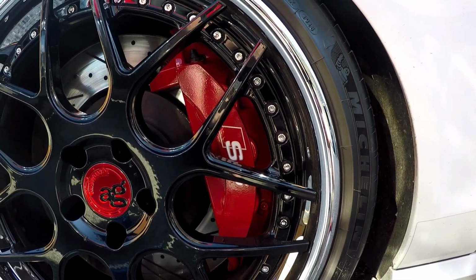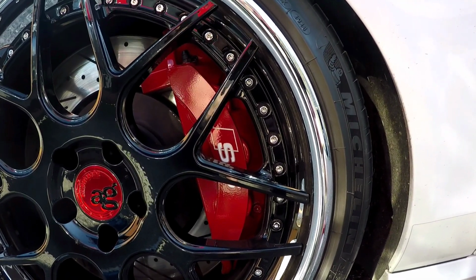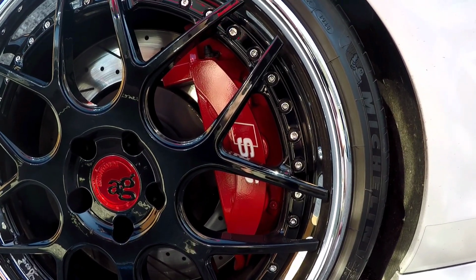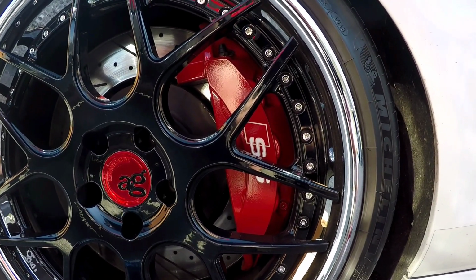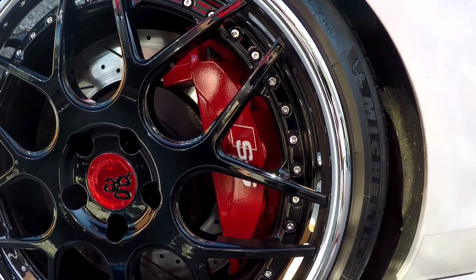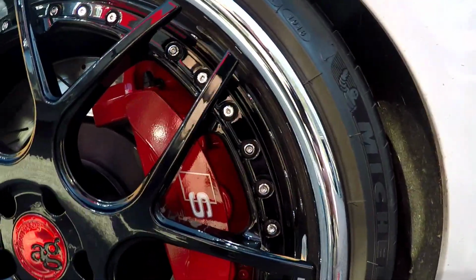Obviously I did 3 coats of gray, and then 5 coats of red, so that's over an hour. That's an hour and 20 minutes if you're waiting 10 minutes in between coats. So you don't have to go exactly by it, but I waited 1 hour after my base coat was done to put on my sticker.